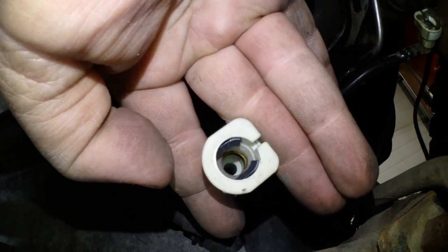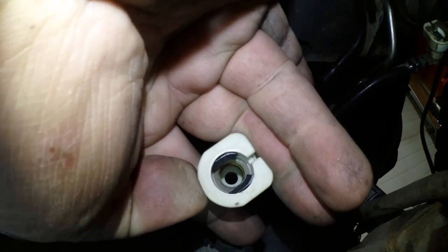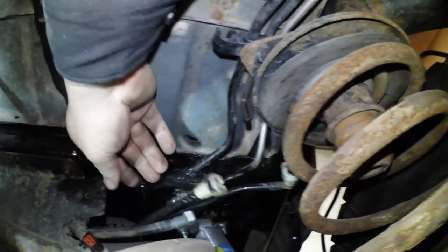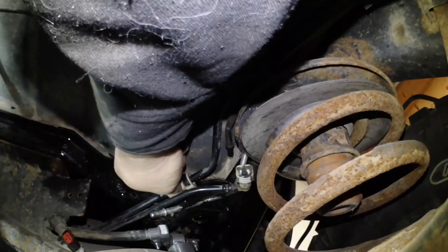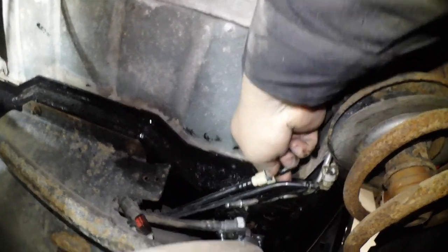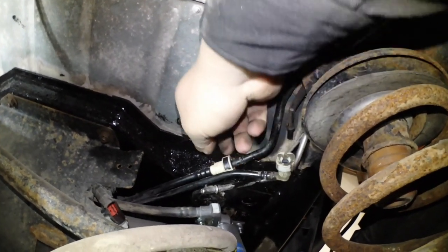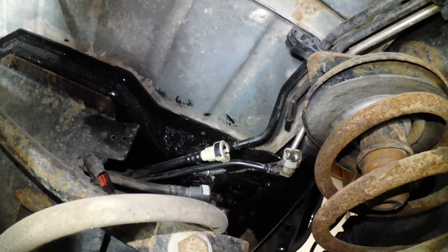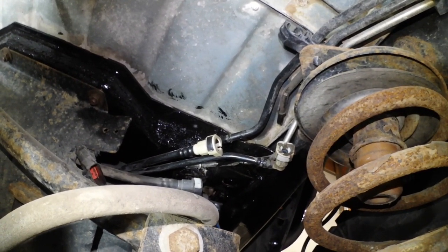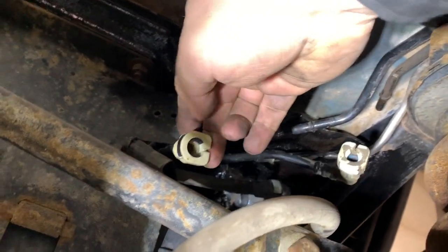To remove them, you squeeze or push down on the plastic clip — that's how it's done. Get up nice and close here so hopefully you can see inside. When I squeeze it, it spreads it open. I'm gonna slide this one on, lock it in place, squeeze down on the middle tab, hold it down while I push off the fuel line connector — and that's how you remove those.